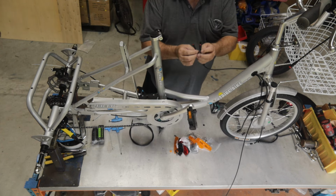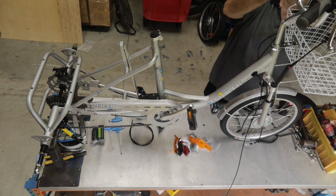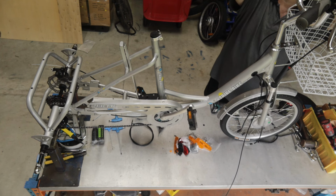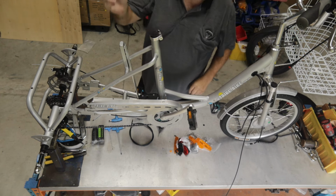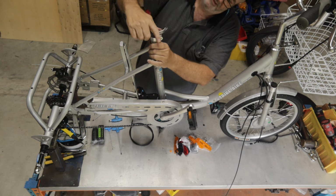This is an electric bike, so we've got a cable harness with 3 outlets. So on this side we've got the keypad, so it goes black to black, and we're just going to rotate it around until you line up the little arrows, or you can feel the little indent. Just going to go around this side. There we go. Push that in, and there's the same for the front brake on that other side. There's a little plug here in the top. I'm going to take that out.